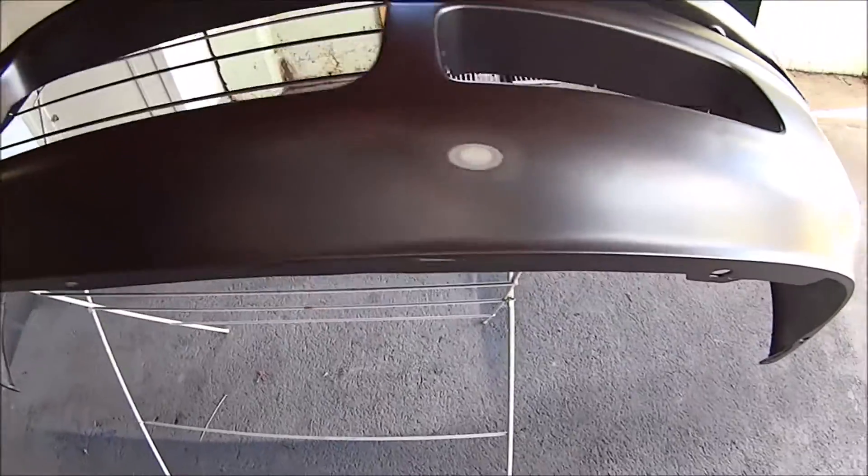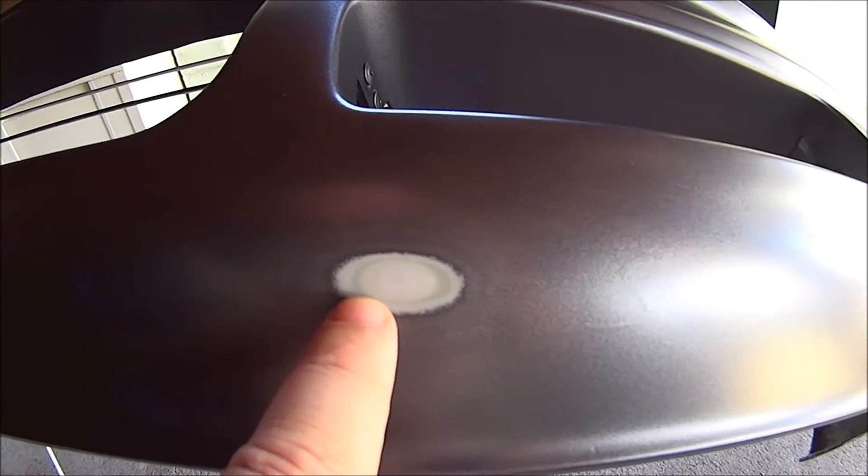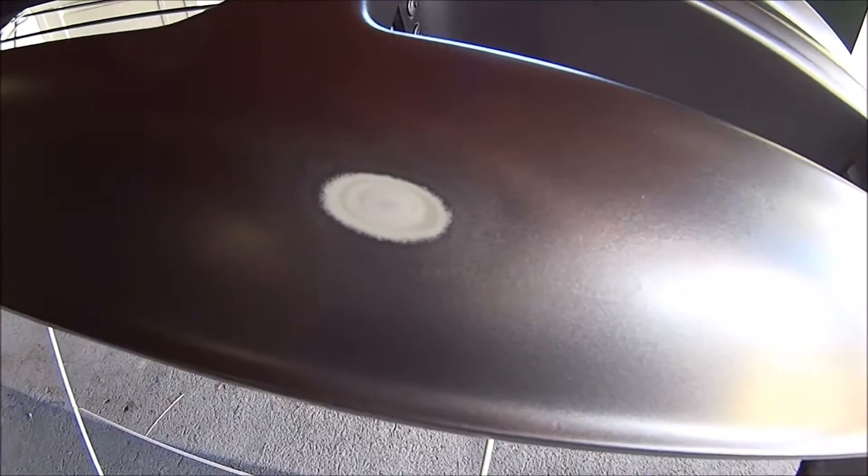Well after all that effort I've had to go right through the paint — this top coat, this is the primer. Seems to be something in the plastic there maybe. I've just rubbed it back with 2000 grit very gently just trying to get through it. There's almost like a fingerprint type of deal happening there, which is what you can see through the paint. Maybe this will be enough to get into it once it comes through — I hope.